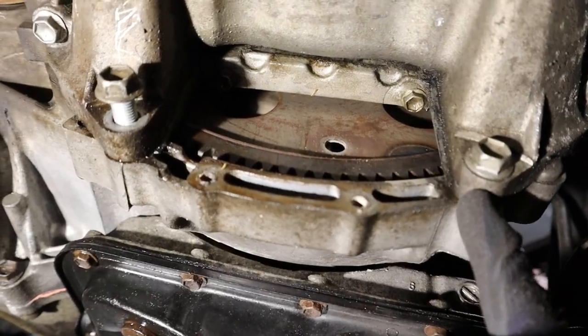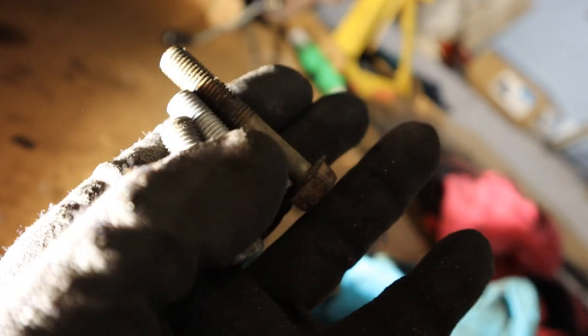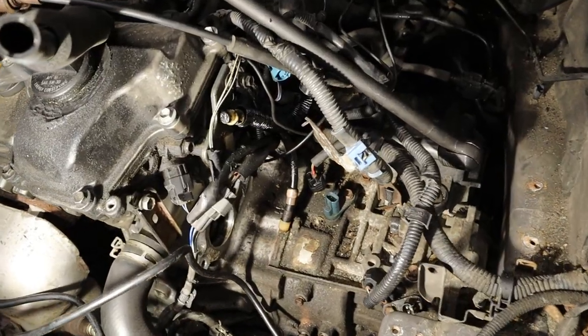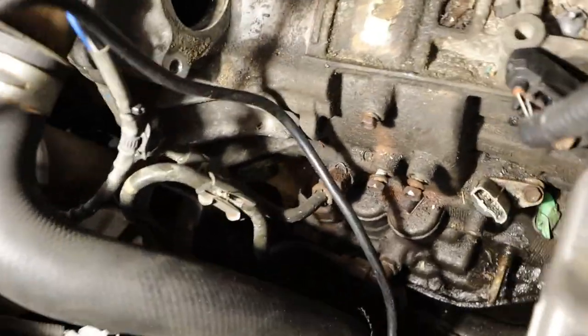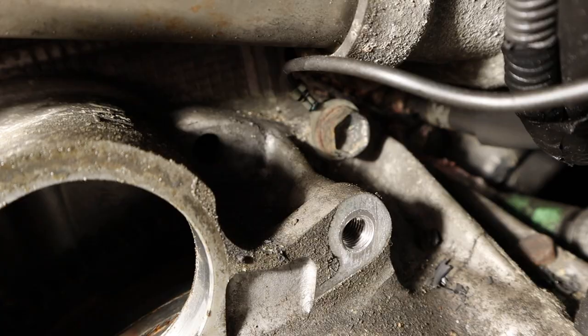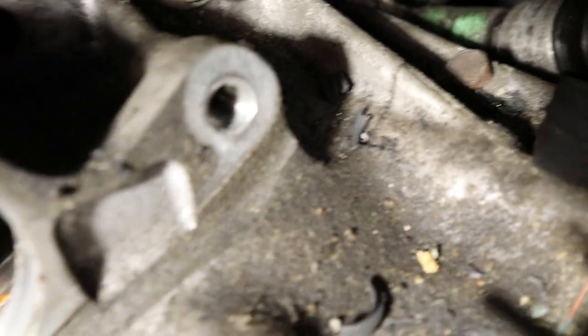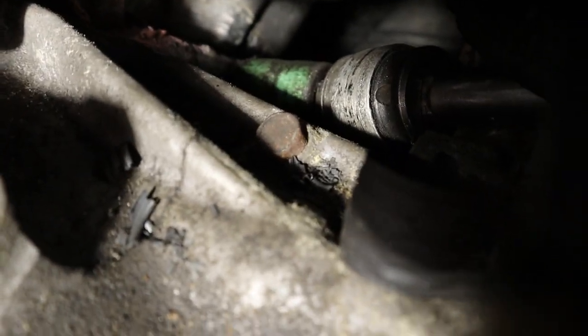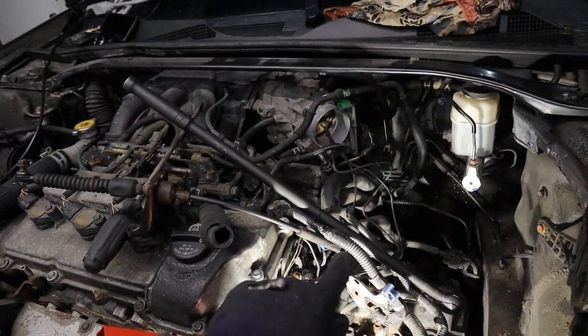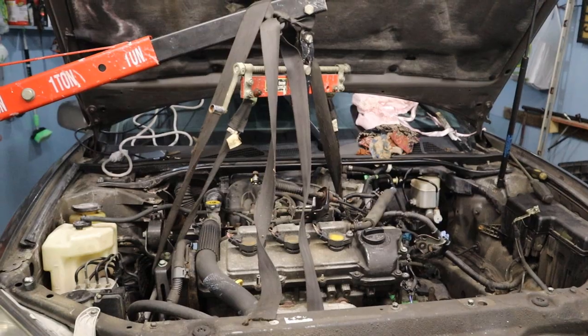There are three 14mm bolts at the bottom — the two bottom ones are shorter and the one near the differential is the longer one. The bell housing bolts on top are a lot harder to get to: there is a fairly easy one near the engine mount, another one just above that, and another bolt just above the starter. Past the starter I am using a socket with a wobbly extension and a long breaker bar to get another 17mm bolt. There is one even further down, but looking up from underneath the differential I have got my ratchet on the hardest bell housing bolt to reach.